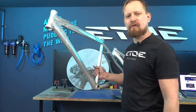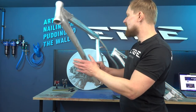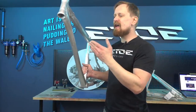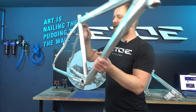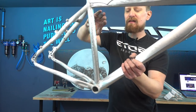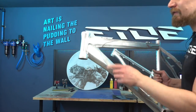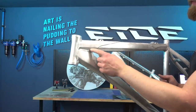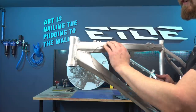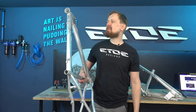There are different reasons for the fail. The first one is it's a very cheap frame — the whole bike cost 85 euros, which is around 90 or 95 dollars. The alloying of this frame is very cheap and there are a lot of strange spots. The frame was powder coated before and I believe it was also media blasted before, and that's why I ran into problems. The tubes are no longer even, there are dark spots you can see here, and it would take days to flatten the tubes to polish or brush them. There are also strange spots in the alloying itself — no chance to polish them invisible.